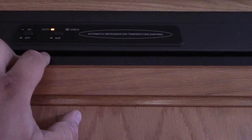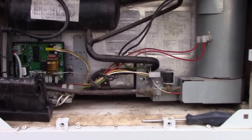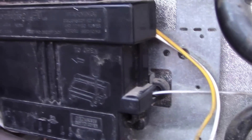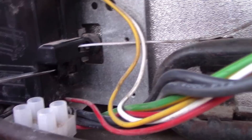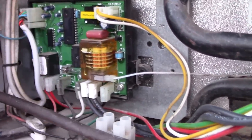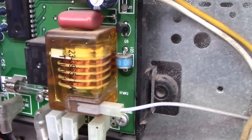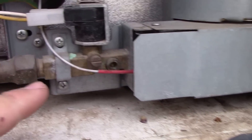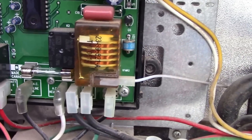What you want to do is remove the back panel of the fridge, which I've already done. There's a little black cover with a screw over the electrical box — take that off. To open the box, put a flathead screwdriver or something small in here and twist it back towards the front, and this will open the box. You'll see a fuse right in here — in my case that fuse was blown, so it wasn't working on 110 volt. It was working on propane because the propane system was fine, but it would not switch over to electric because that fuse was blown.